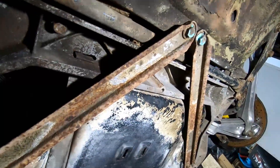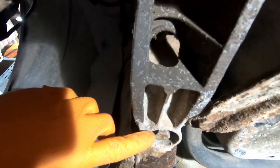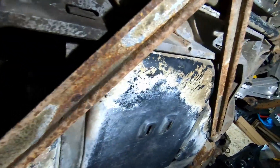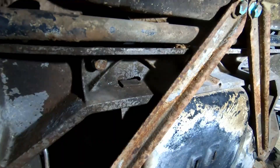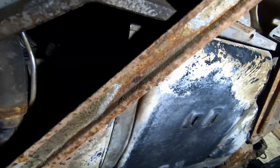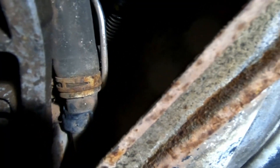So where's the focus for today? This is the subframe with all the various components attached to it. You can see you've got a suspension arm, suspension arm, sway bar, and then it connects to the body there and also via that point as well. We've also got our bolts for the steering rack. Dropping this will then allow me to make sure everything's clear up there, and you can see up into the area around the fuel tank.